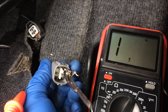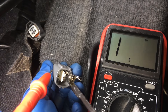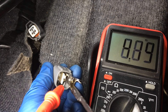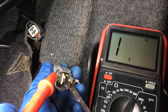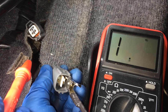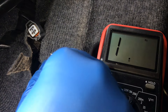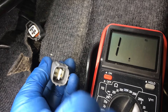The other fail result you could see is the opposite - if you get in here and there's zero resistance, that would be a short. Also, adhere to the ratings that are listed at 11 to 16 ohms. If you get in here and it's 20, replace it. If you get in here and it's 9, replace it - assuming you're checking it at the right temperature, because the resistance value does vary based on temperature.